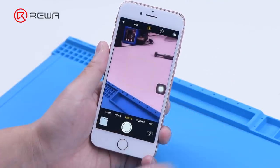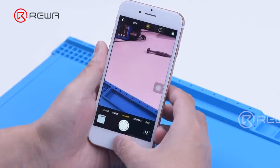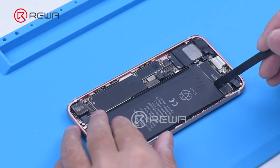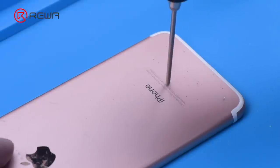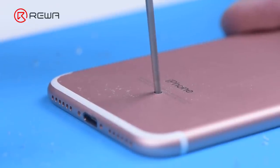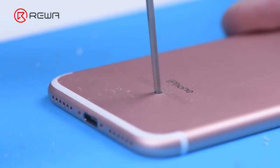Then install the camera back to the iPhone. The camera can be opened normally. The next step is to turn the iPhone into a night vision camera by installing an infrared lamp. The infrared lamp needs a power supply to function, so we install an external power supply of 13000mAh to upgrade the iPhone battery. The external battery supplies power to the phone and infrared lamp simultaneously.